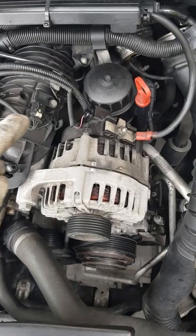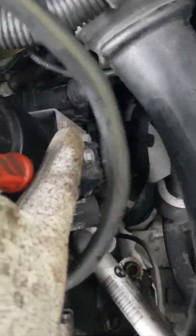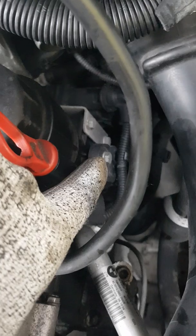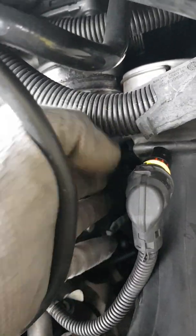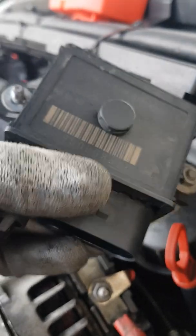So basically I've removed the engine cover and just undone this hose here and moved it out of the way. You can actually see right down here is the Glow Plug Control Unit. We're going to loosen those — I believe 10 mils — and move that bracket out of the way to get to it. I've managed to get the bracket off. That plug there was a bit difficult to get out; there's not much wiring on the plug so you couldn't really pull it out. So that's basically the first wire you need to remove.